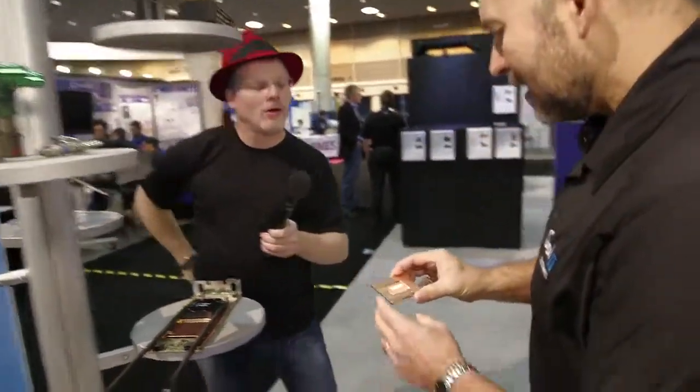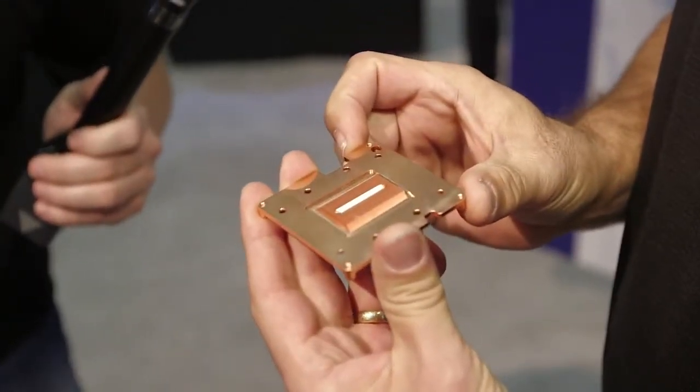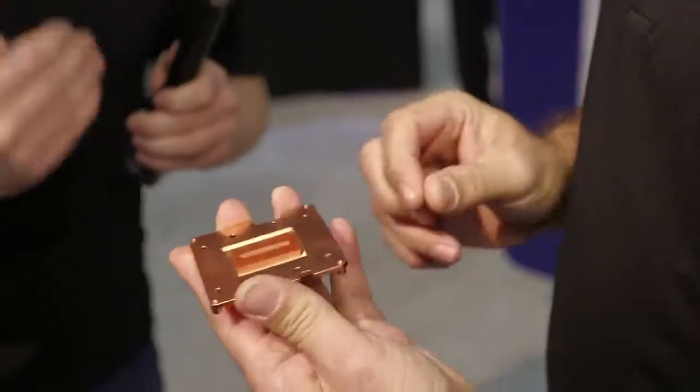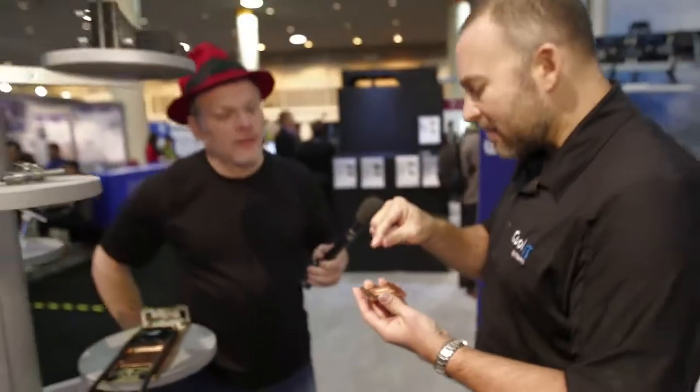Inside that K80, just like the rest of our solutions, is a micro-channel heat exchanger made of pure copper. We use a patented technology we developed called split flow. We drive the cool liquid down into the center of that construct and it splits in two different directions. We get the cool liquid in the middle, and it has the added benefit that the coolant can move a little bit slower — it has low flow resistance so we can support many more processors with very little flow. And yes, we absolutely used CFD to get it tweaked the way we wanted.